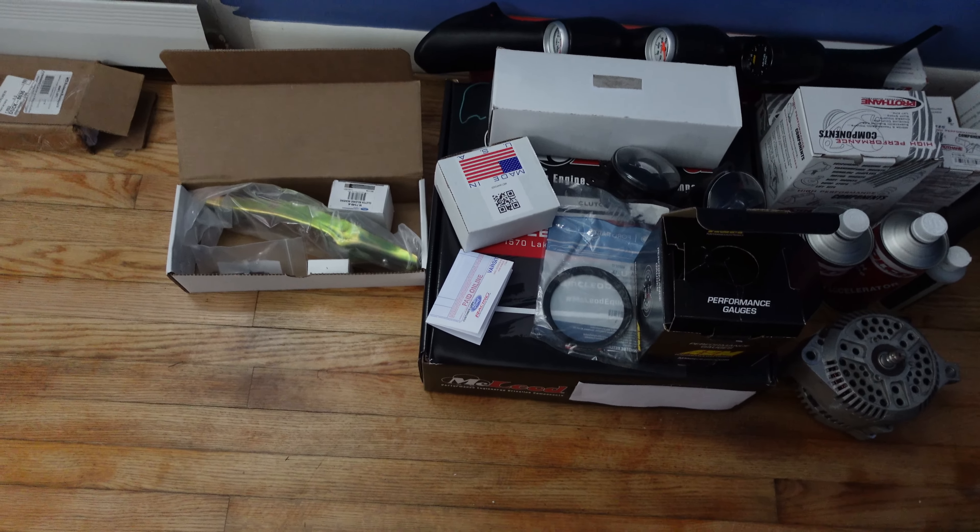Now as far as the big thing that I teased at the beginning of the video — the thumbnail — I did a little teaser in a video about the Bronco. So Cobra people, I don't expect you watched the Bronco stuff, but if you did, you got to see this, which is an off-road X-pipe. Now you're thinking I already have an off-road X-pipe, so what's the big deal? It's because that is now connected to a set of long-tube headers — these are American Racing headers. I'll have to look — I can't remember if I got the 1-3/4ths or the 1-5/8ths, I'll put a text on screen of which ones I actually got.